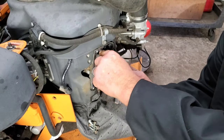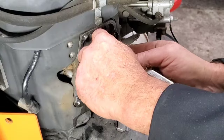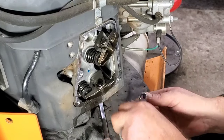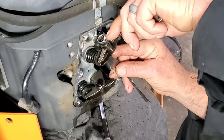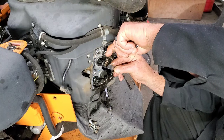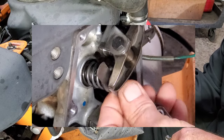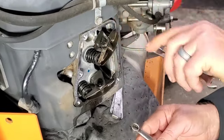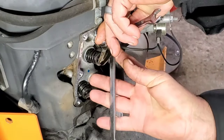I'm going to take one wrench on the top on the bolt and hold it still while I break that loose. I'm going to loosen that nut off and leave a little bit of tension on it so it's just not flopping around. Then we're going to take this wrench and turn it until I get just a tad of drag — there's my drag right there. It kind of wants to bend it a little bit. Just a little bit of drag. Now what you're going to want to do is hold this top bolt and tighten your nut back down.